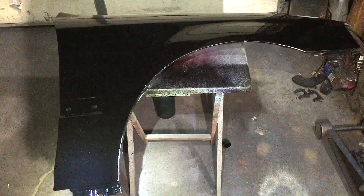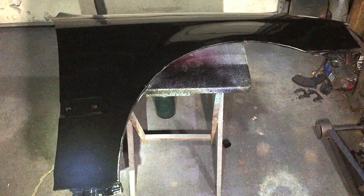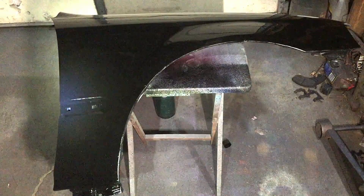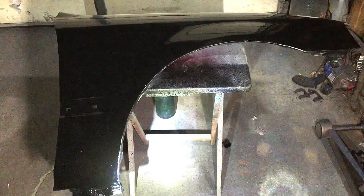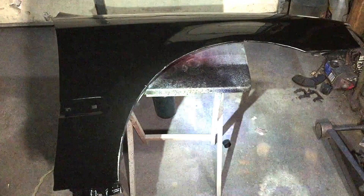This is what you want — you want it to have a really glossy, reflective surface. Basically the whole panel needs to be wet. That's how you should shoot paint anyway, to where it all blends and has one smooth, wet look to it. That's how you keep from tiger striping. It has a really nice, glossy finish. We'll go one more coat over this after this dries for about 10 minutes. I didn't prep this thing to look super perfect, so there are imperfections in it — you can see them right there. This is just a demonstration.